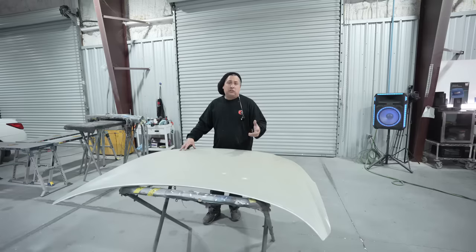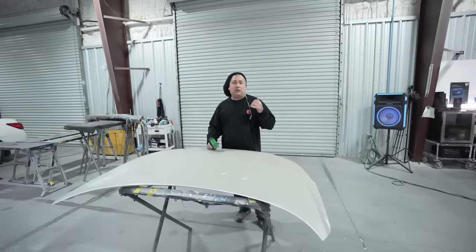You guys know that we usually use an epoxy here. So if you were to strip this down, you could hit it with your epoxy and then move into the paint like we did before with PPG. With this one here, being that we have almost all of the E-coat still on this hood because we bladed it off, we're gonna treat this as if it was a brand new hood that we purchased. I talked to Pat, he told me that those are the recommended procedures. If you have a lot of bare metal showing, you're gonna wanna hit it with your etch wipes and then 3 coats of urethane, or you're gonna use your epoxy as we used to do in the PPG line.